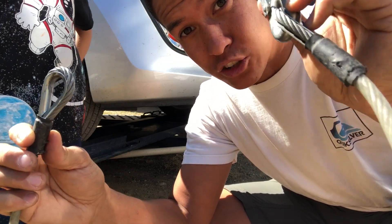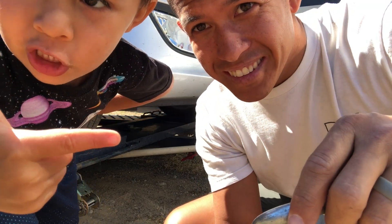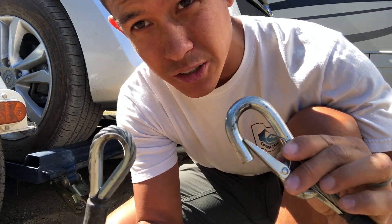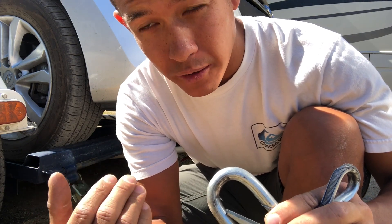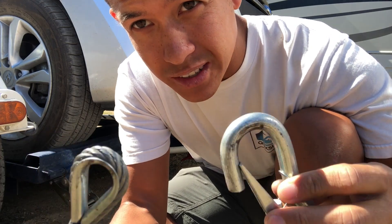This is a type of safety chain — some are actual chains, but this one is a plastic-coated cable. Each safety chain is rated for around 2,000 pounds, which isn't the entire weight of the vehicle, but keep in mind this is just for emergencies. If the tire straps were to break and the car was ready to roll off — this is a redundancy to the redundancy. The car wants to stay on the ramp regardless.